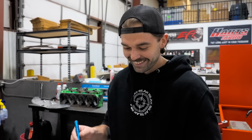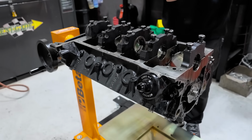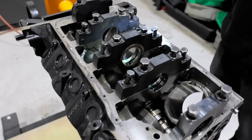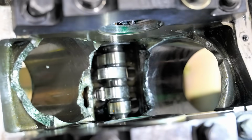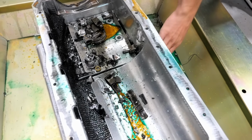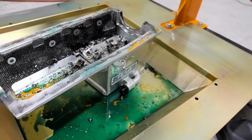Okay. All right, we have got our engine 100% disassembled now. We can actually see exactly why this thing continued to just dump water into the oil pan. Keep in mind, the hole in the pan is up here, right? It's way up here. It's still got this whole sump down there that's normally full of oil. But when we had kicked the rod out of this at the track, it just continued to pour out of there. And we don't have 10 gallons of oil in this engine.